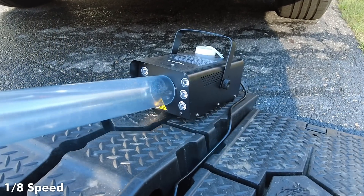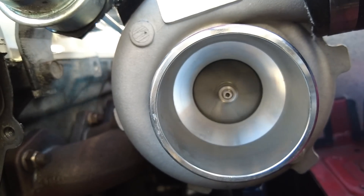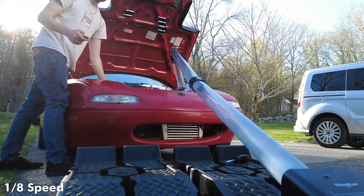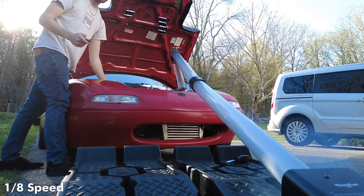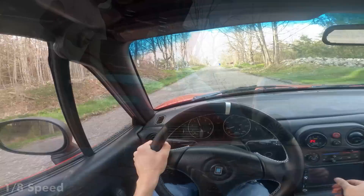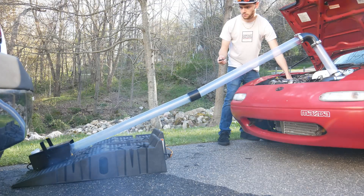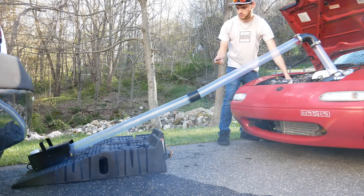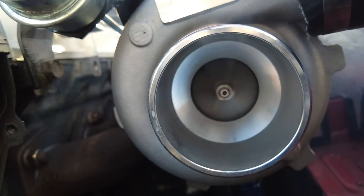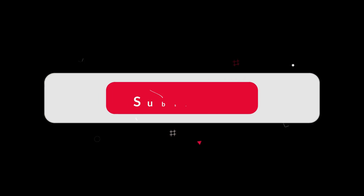It's not easy for this air to escape the turbo without a blow-off valve — after all, your turbo is spinning super fast and its job is to compress air and push it towards the engine, not let air back out. Because of that, you have a lot of pressure past the turbo, but your turbo is still trying to compress and it ends up fighting itself. That's how you get compressor surge. When you let off throttle and hear that sound so many people love, your turbo allows air back through it, but not smoothly — that's why you get that sound and pressure waves coming back through your intake. You can actually see in this clip that the air coming out of the intake pushes the fog machine away from it. It looks great on camera and sounds really cool, but it's not great for your turbo.